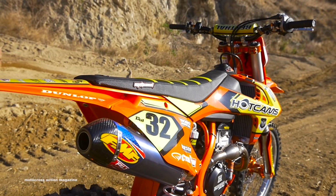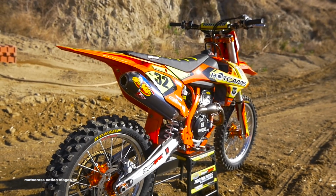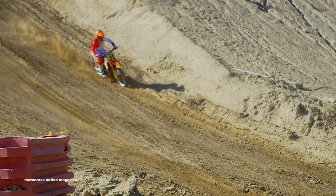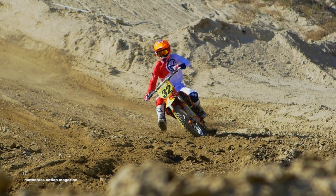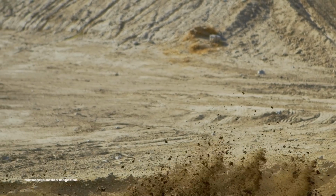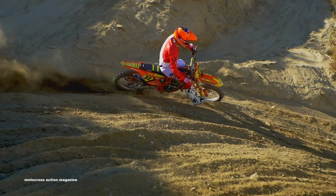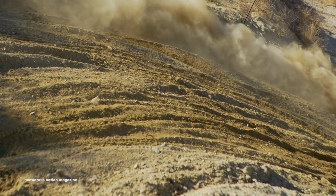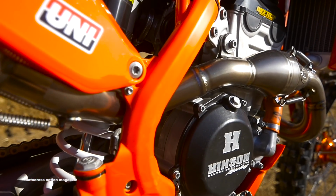Racetech didn't make the engine into a high-strung machine. They made the engine faster across the board, yet easier to ride for all skill levels. The bottom end had the pickup of a YZ250F. It was more responsive and revved faster through the power band, getting to the meat of the power quick. It made the power band feel shorter, but every rider liked that you didn't have to wait till 14,000 RPMs to shift. Being able to short shift made lower level riders more comfortable to ride the bike. Faster riders were able to ride a gear higher coming into corners and felt they were able to use the clutch less. They said the power from bottom, mid, and top felt more connected.